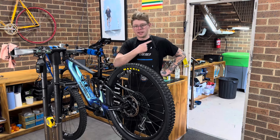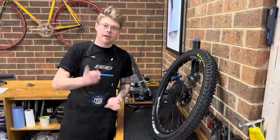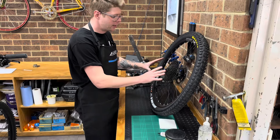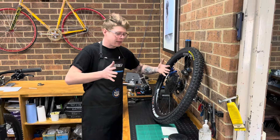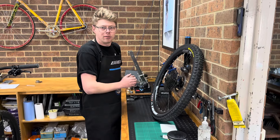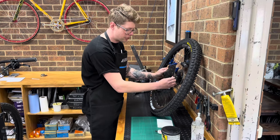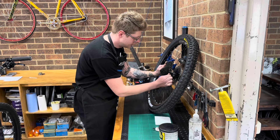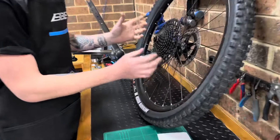First you just need to remove your wheel and get it on the workbench. For this job we're going to keep it super simple — we're going to leave the cassette on the freehub body. The DT Swiss hubs are held together by a tolerance fit, so being in the frame and done up tight is what holds the hubs together. When they're outside the bike there's not much holding them together, so we're going to use the cassette for leverage, rocking backwards and forwards to pop off the end cap. The end cap is what's holding the whole hub together.